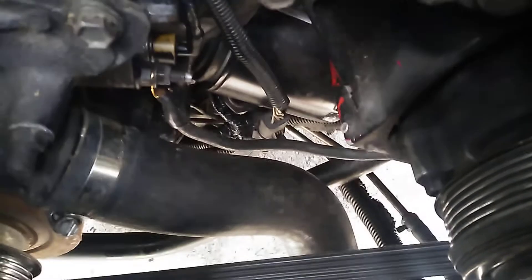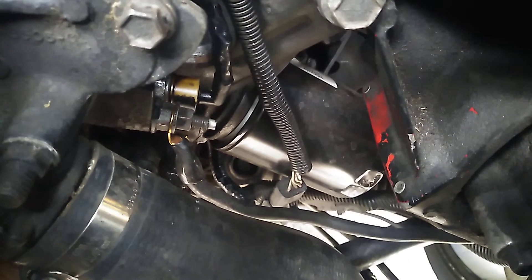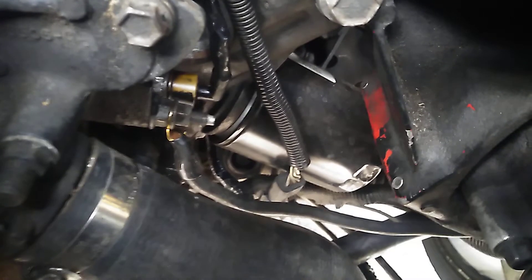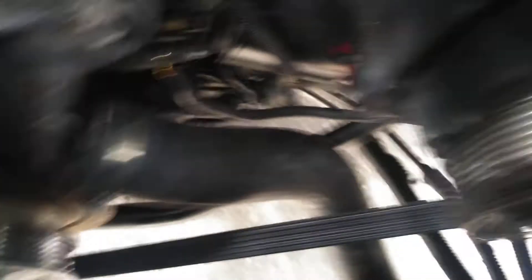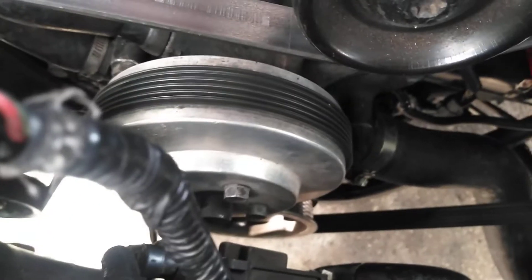You'll see it right there in front of the filter. I also pulled the cap off the oil pressure sending unit right there and screwed the other piece in — it was leaking. It's not leaking anymore. I've got it back up, taped up, loomed the harness, and through the bottom there I loomed the harness to the O2 sensors. I put a new harness that a buddy of mine had on his car.